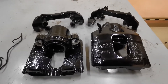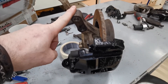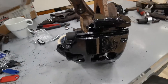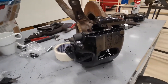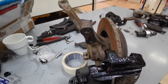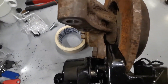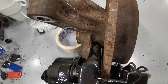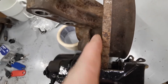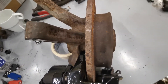So that is the basic brake conversion for the Fiesta. I've got this hub unit here and I've fitted the new powder coated parts to it, which just look really nice when it's all put together. When we look from the top we can see that the brake disc is very close on one side with quite a big gap on the other side.